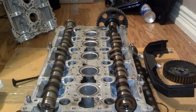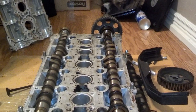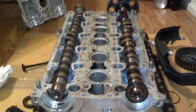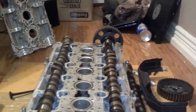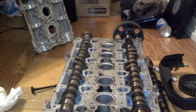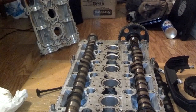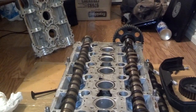Now, when you're looking at the front of the motor, a retard is taking the top back. So you're going to turn the actual cam counterclockwise. Then, when you do the exhaust, you're going to turn the back of it so that the front of that cam turns clockwise. The best thing to do is to time this with the cam sprockets on with a special tool that IPD sells — you put that on there and make your little adjustments. It's a two degree adjustment — not two percent, two degrees. A full circle is 360 degrees, so you're only going to move that two degrees.